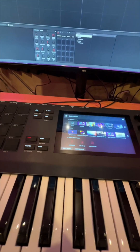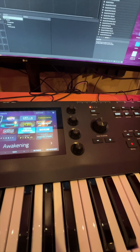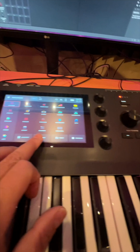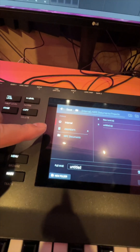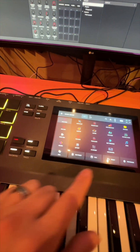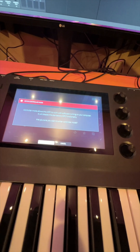Now that we have it installed, let's fire it up and see if the drive is recognized by the MPC Key 61. I'm going to create an empty project — the key is to make sure we can save to that drive and not the internal or the thumb drive in the back. Going to menu and hitting save, then save project as... it's not showing up here. I just have my internal and a thumb drive. So we need to hit cancel — I believe we need to put it in controller mode because we need to take it into the computer to reformat the drive.